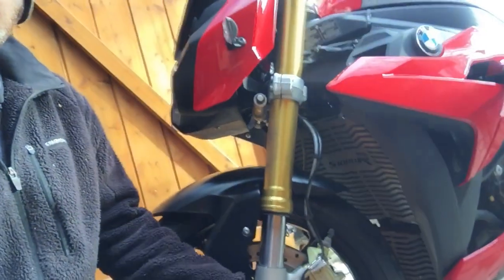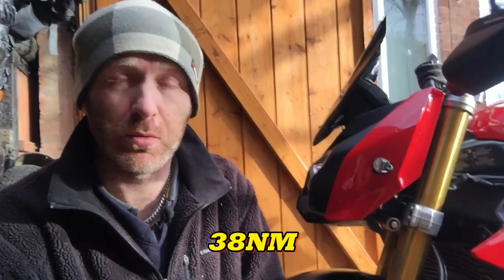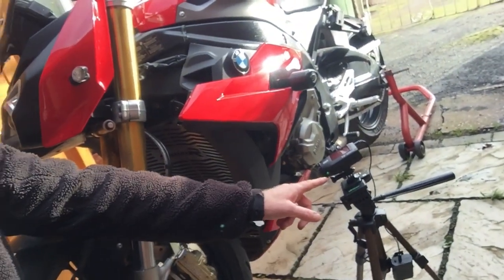Today we're doing a long-awaited video to change the front brakes on the BMW S1000R. I've got myself some front brakes, two sets of bikes out here on paddock stands. I'm no mechanic — I just picked these bits and bobs up over the years playing with my bikes. I've got a Haynes manual which I use for reference. The torque for the bolts is 38 Newton meters. I'm at 25,000 miles now and the pads are finally shot.